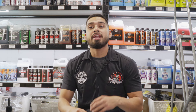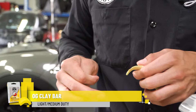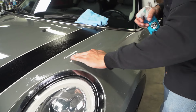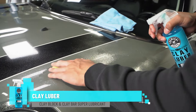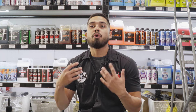By using the complete clay system paired with the OG clay bar and clay lubricant, it's going to reduce all that static friction and contamination. Open up your clay bar, rip off a small portion, and pair it with your clay lubricant. Once you have your small piece of clay bar with a three-finger-width grip, walk over to the surface. Spray a very generous amount of lubricant across the area you're going to clay, and spray some onto the OG clay bar as well — this reduces friction and prevents marring.